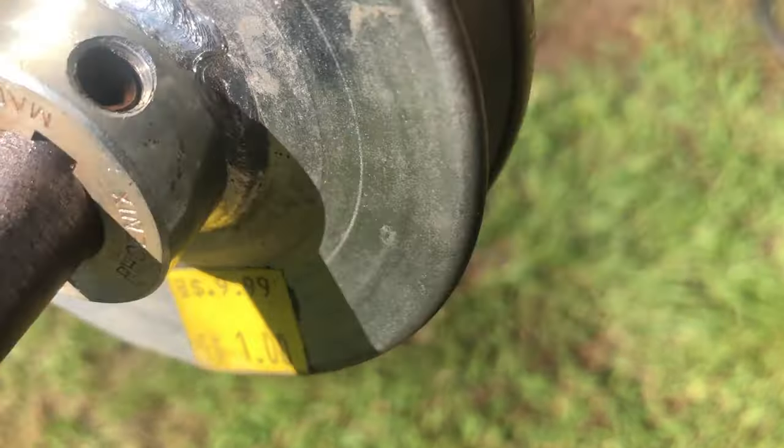If we pop the hood, I don't think I'll ever hook up the choke because you're going to start it here anyway. This is your choke. So choke it, start it, take the choke off. There's my key switch. I do want to put throttle and a kill switch up here. Other than that, maybe a front bumper. I've got that nice piece of steel there. That'd make a good front bumper. But for now, I just want to drive it, see how the 5-horse does.